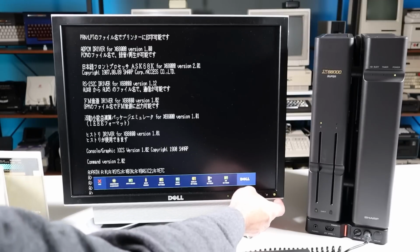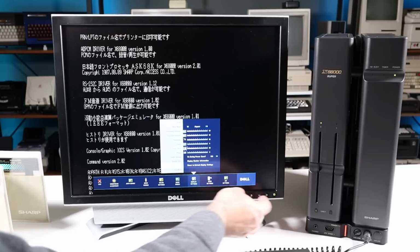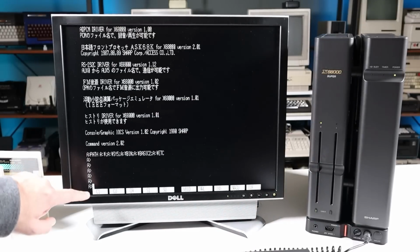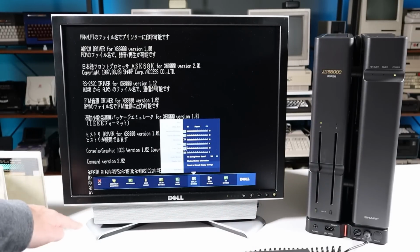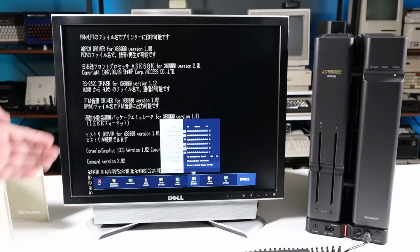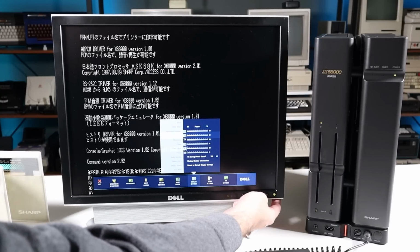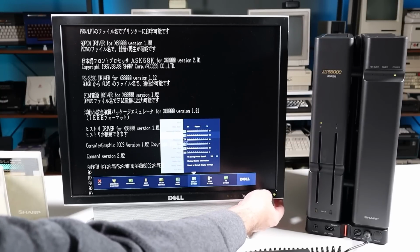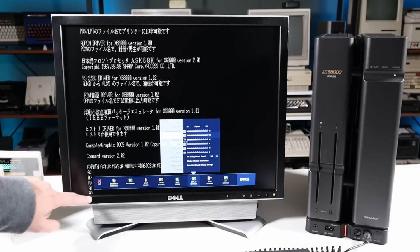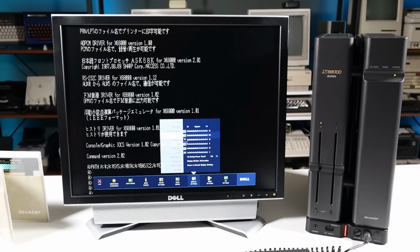And if we go into the screen settings here and we go to display settings, and then we go to display reset. Watch carefully. There's the prompt. Below that, there's even a status bar, and it tries for a moment to sync up to it and to display the entire screen, but it just can't. And if we go here to the vertical position and we move it up to its maximum adjusted range, we still can't even see the prompt, much less the status bar that's below it. So LCD screens just aren't a good fit for the resolutions that this thing is putting out.